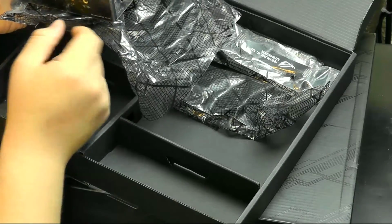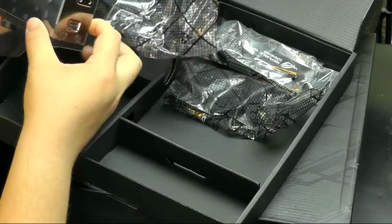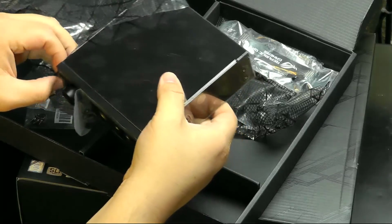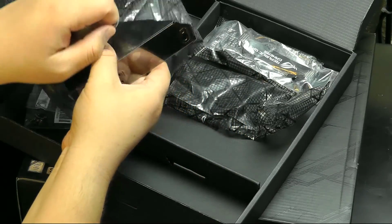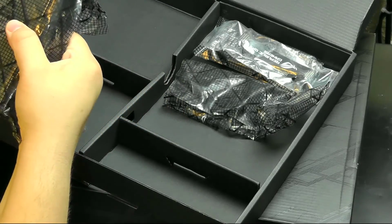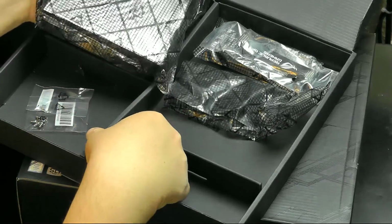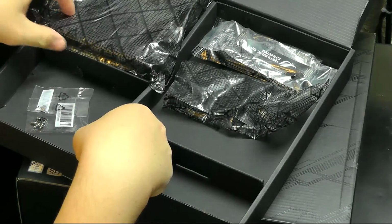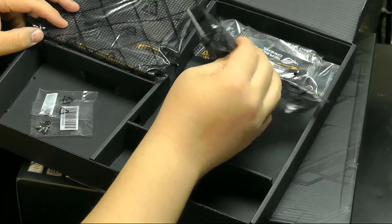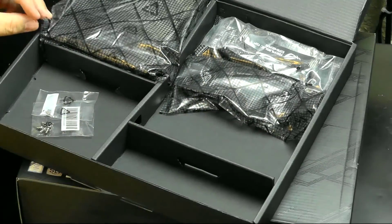And keep in mind that this actually requires a USB 2.0 header. So if you're limited on USB 2.0 headers, you're going to have to make a sacrifice somewhere, or take a gamble on an extension. I know they sell some online where you can plug it into your motherboard USB 2.0, then route it to the back of your case and hide it to expand a couple more slots. But I've heard some horror stories about those little things frying the motherboard, so I am not willing to take a gamble on this motherboard. So I will probably just lose my 2.0 headers on the front of the case.